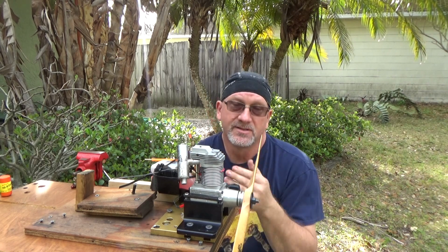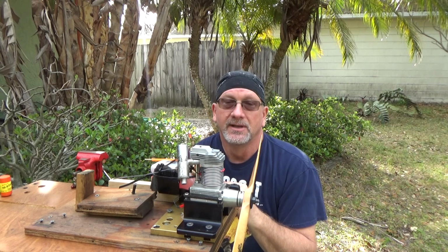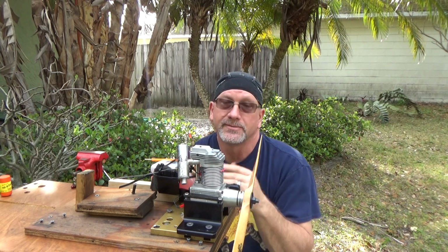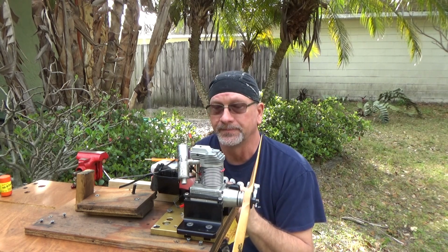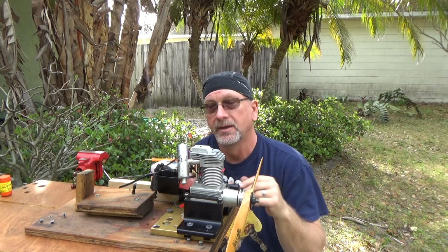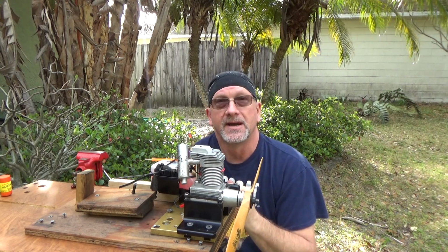One reason is because trying to feed it through these pushrod tubes and get it tight enough, that was about the best location I could do, so I don't want to hear about, oh, you shouldn't have put it there, because I really don't care. That's where it is, and that's where it's going to be for this run. It's just a data point anyway. So, new Enya number 3 plug, new 15 by 6-10 prop, Omega FAI fuel straight from the bottle, and we'll see how it does this time.